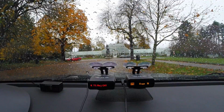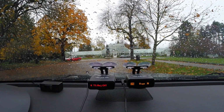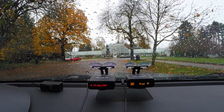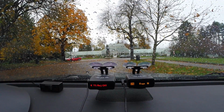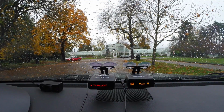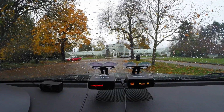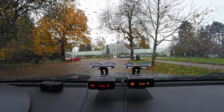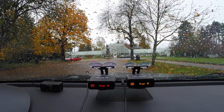Traffic filter off. And what this is for is just like TSR, it introduces a delay. TSR low has less of a delay. TSR high has more of a delay. So high will be quieter at the expense of performance. What I found, TSR low is okay at filtering out false alerts. It does a pretty good job, but you definitely do still get some poking through. If you set it to TSR high, that definitely quiets things down even further. So low is going to be kind of a good compromise.